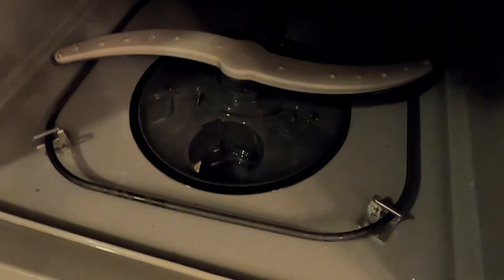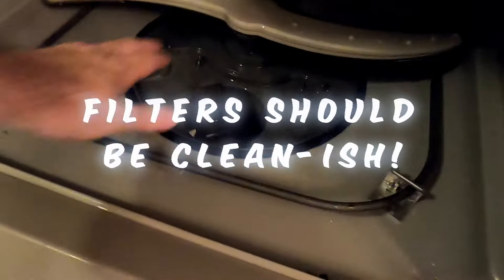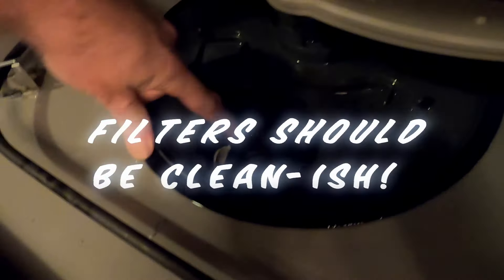Hey, it's Kilobyte here. What day is complete without your GE dishwasher giving you problems? In this case, it's a FTD error — failure to drain. The good news is it won't be as bad as it could be. You'll want to get all the water out of the bottom, remove the covers, and right there is your pressure sensor. That is most likely dirty. You don't have to pull the dishwasher out to get to it.